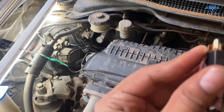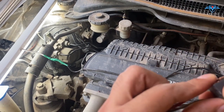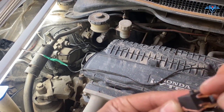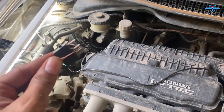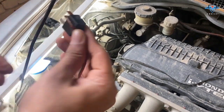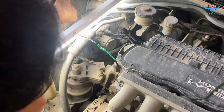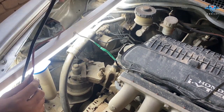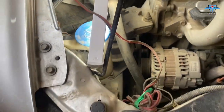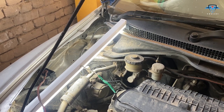That's it, that's all you need to do. Let me disconnect the battery first. Done. So now we have the relay all ready. Just make sure the wires are not touching any other ends, and just like that put it back in the box right there. The connection - this is how I have connected the relay. Now these two wires are coming out. All we need to do is put a switch between these two and then we are done.